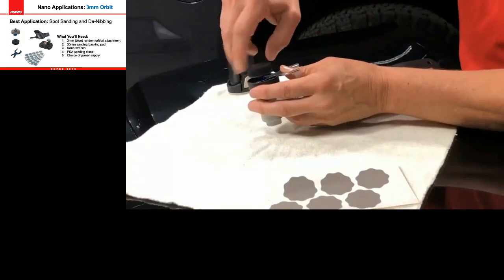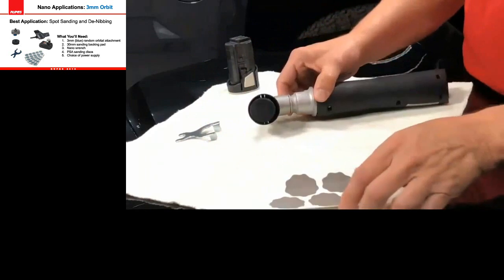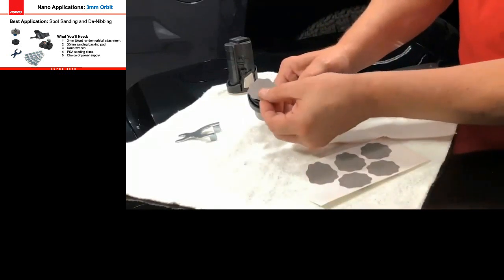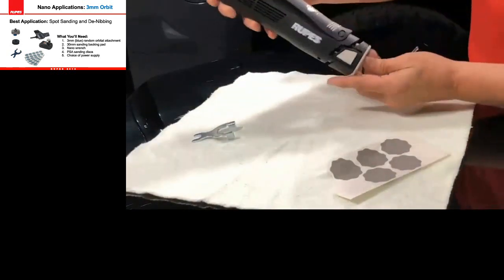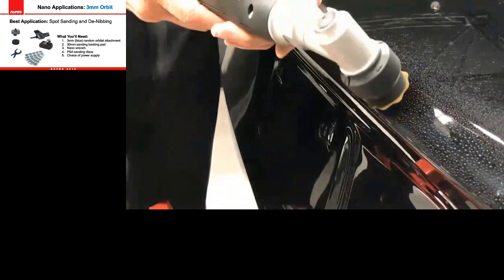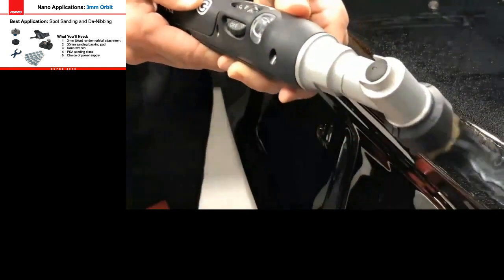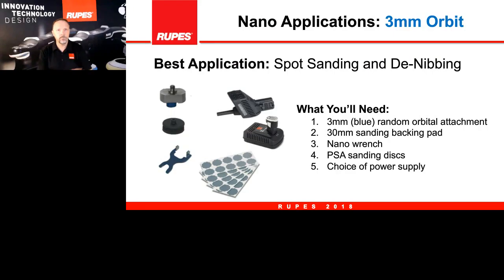When sanding with the nano, make sure you get the sanding backing plate installed onto the nano polisher. Take your sanding medium — included in the kit are 2000 grit and 3000 grit, and on the marketplace other grits are available. These are typically called daisy discs — sticky discs you stick on the backing plate. Select the polisher to the sanding speed of about three or four, mist some water onto the surface, and apply the speed paddle. This demonstrates the sanding function on the edge of a panel.